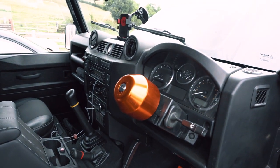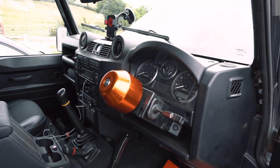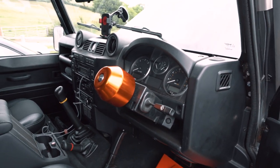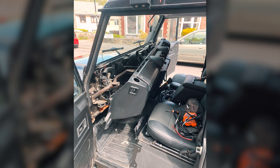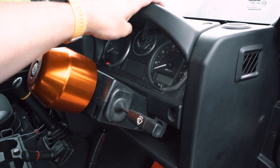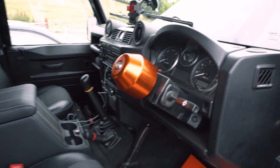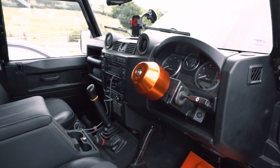the trickiest bit, and the bit that was putting me off doing this build, was the removal of the dash. So I'll place some video or some photos of when I was doing the job, but effectively all of the dash has to come out to ensure that you can run the wires nice and tidy. There's lots of small screws all the way around the dash. The steering column has to come off, the instrument panel had to come off too, but I followed some guides on the LR forum and I'll post a link in the description below so you guys can check that out.